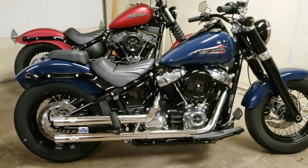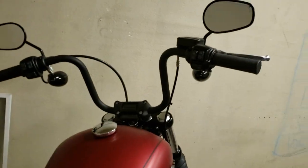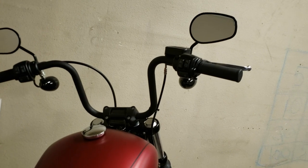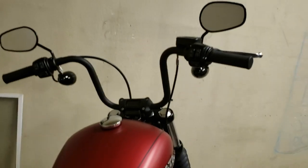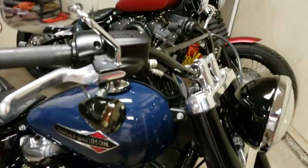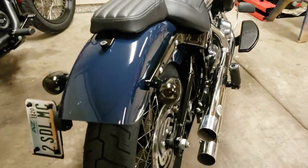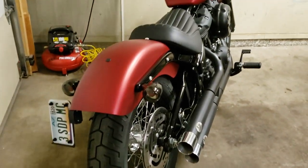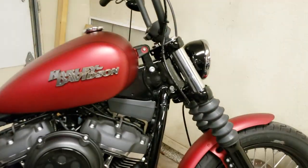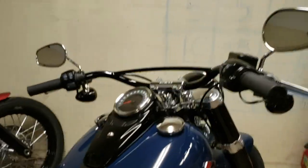That covers the questions. Let me finish up with our plans for both bikes. Anthony's first: this coming Tuesday we're installing new bars. His current bars are 10-inch stock at 33 inches wide; we're going with an 11-inch high bar at about 30 inches wide called Pudgy Bars — a convex shape from Dean Speed Customs. We've also both done the blacked-out lenses from JMP Cycles with colored bulbs — a really cool upgrade for about 20 bucks plus shipping. Anthony also has a 3-inch Dean Speed Customs tank lift and the Rampage slip-ons.